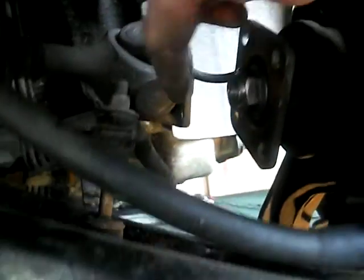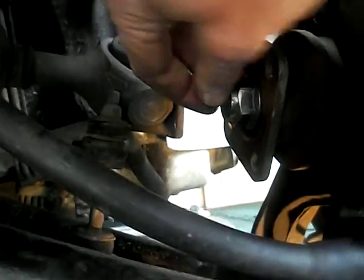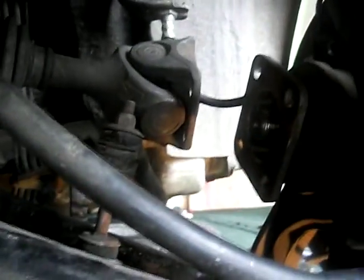The FSM — that's the factory service manual — says clearly: do not uncaulk this, which I presume means don't try to unpin it from the stakes. A lot of people have different ways of doing that. One way is using Dremel tools and other methods to grind it off and get in there. I opted to just go with the factory service manual.